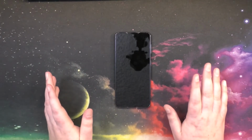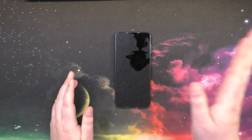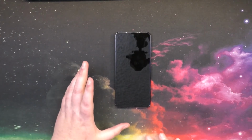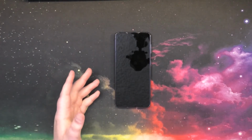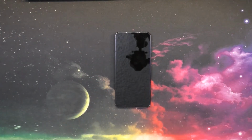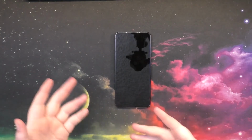And the other unfortunate thing is if I put a T-Mobile SIM in here, it'll blow it all away. Thankfully, you get a chance to get your SIM back out before something happens. It'll prompt you to reboot, but if you get your SIM card out, lock the phone, and when you unlock it, the reboot prompt will be gone, and the phone will no longer be switching back over to T-Mobile. But yeah, it's a really involved process, and it's really just outright dumb, and I don't know why Samsung is taking so long to fix this.